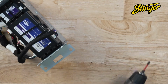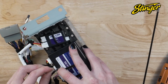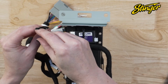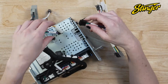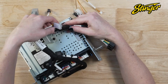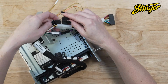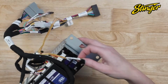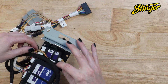Connect one end of the pack to either port on the PL1. Connect the other end of the harness to the expansion port on the CH1A SRK module. Secure the radio harness to the PL1 harness using a zip tie. We will connect the 3 connectors to the radio harness and then plug it into the IX212 radio module. Connect the 3-pin pack link lead into the PL1.